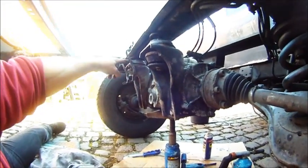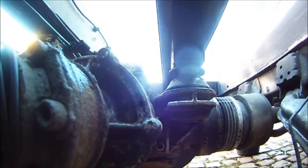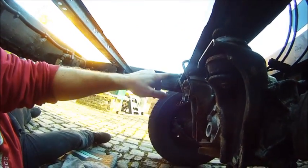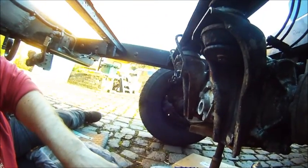You need 2x 21mm spacers at the back and a 15mm spacer on the one at the front. What I'm able to do is take one bolt out, fit the spacer, then remove the next one and fit the spacer — so we've always got a bolt in, and obviously we've got a jack supporting it as well.